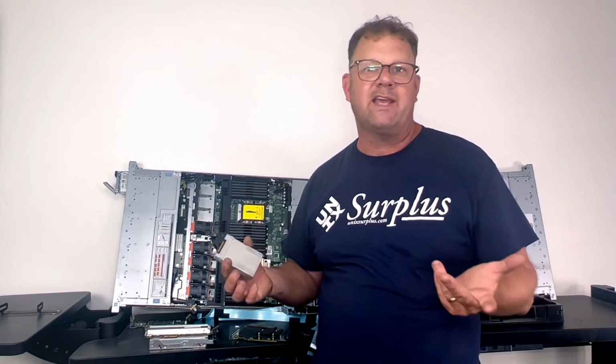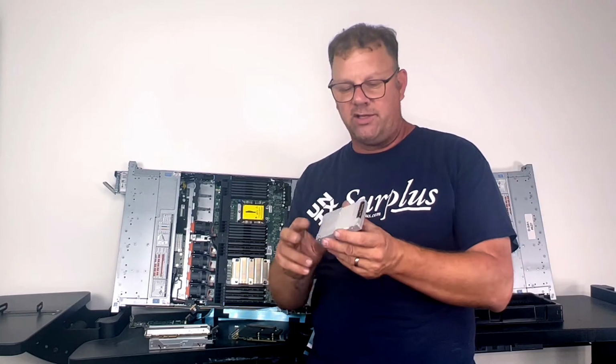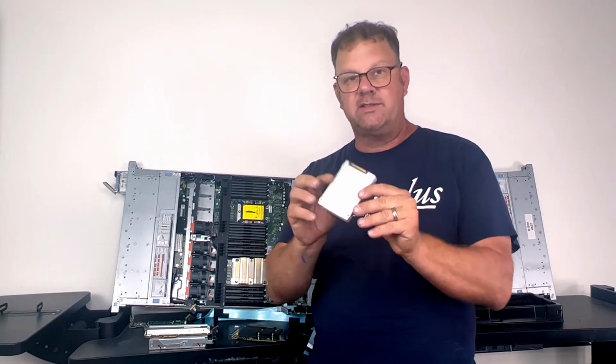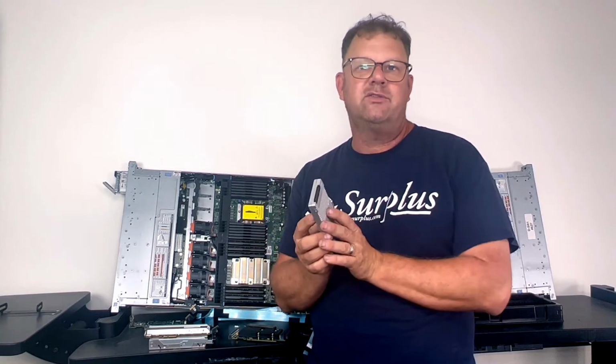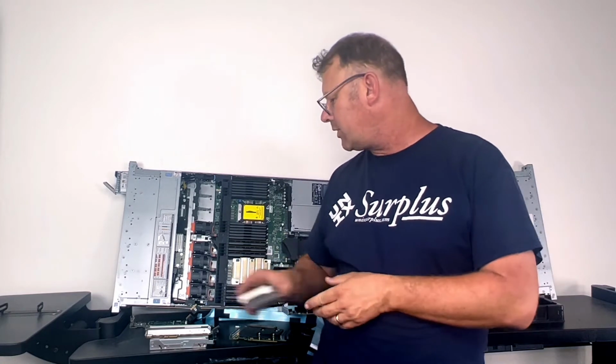They had to have SATA and SAS modes. And that's where you came out with the U.2 format. This is a typical enterprise U.2. You can see that it has a big heat sink. Intel tries to do those big things to get a higher temperature range and attract higher temperature range customers.